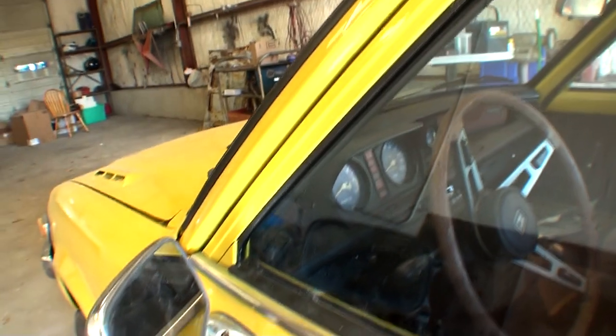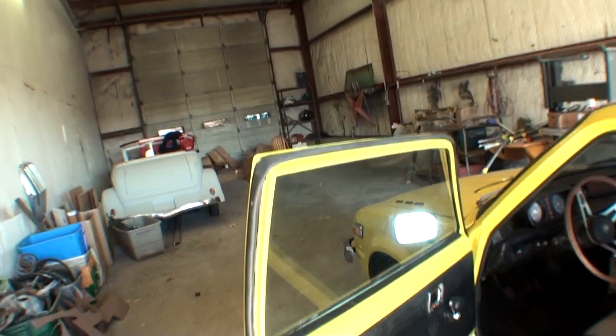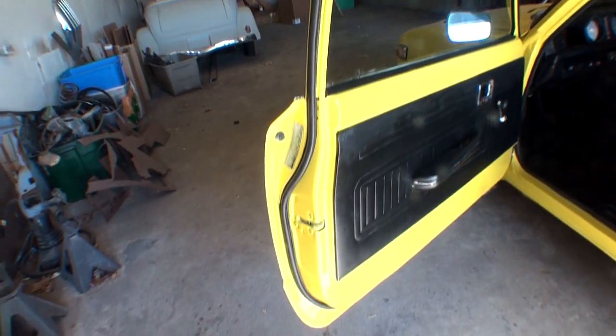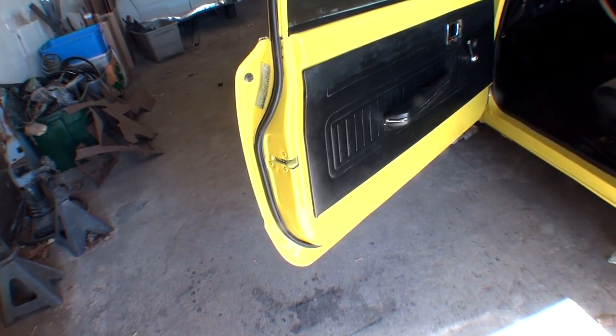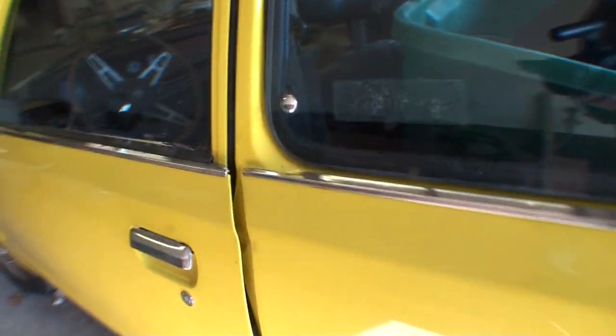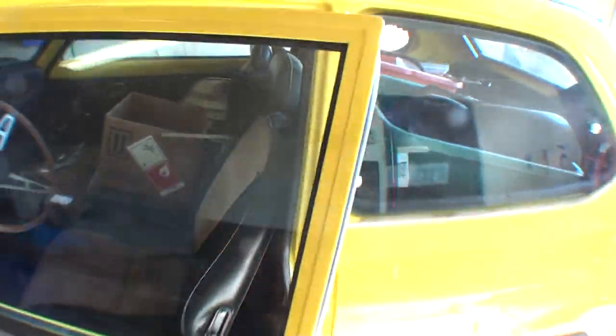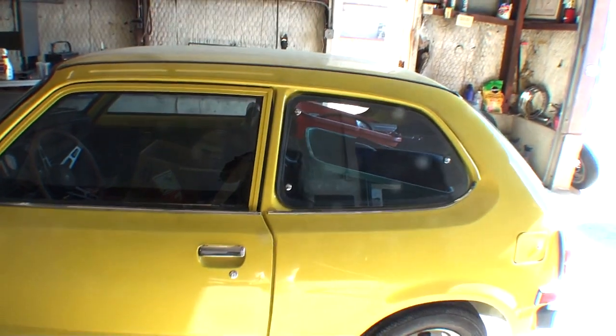And I want to make sure and clear that everybody sees that this window rolls up in here perfect. Now, he did go ahead and supply this rubber here, the inner scraper as well. He supplied the door seal rubbers, which are kind of like the originals, but not identically exactly. So when you close the door, you can see that the door doesn't shut properly. And to really seal it properly, if it even seals at all, you got to slam the door shut to make it work right.